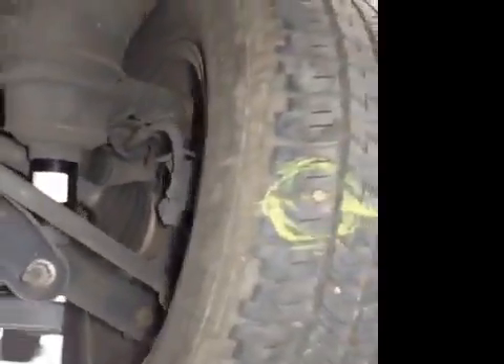Moving through to the rear of the vehicle, no signs of any leaks in the underside or in the exhaust system. Nearside rear tyre — tread depth is in the green on this tyre, no cuts or bulges in the sidewalls. Nearside rear and offside rear suspension and brake discs are all okay.